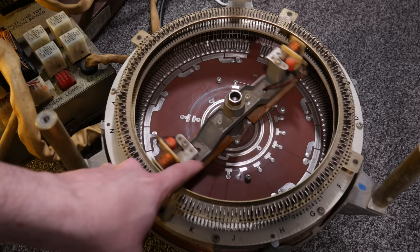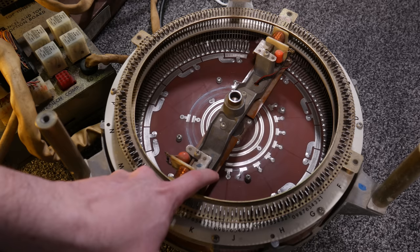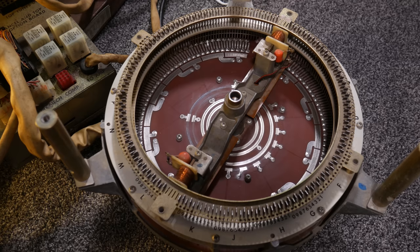But there were also even more expensive selections. They were called like the red button and the gold button, and they might take off 5 credits. So that's what's going on with all these patches. The armature could spin and go bup, bup, bup, bup, bup, fire the deduction solenoid 5 times, and there go your 5 credits. But one of the features that is absolutely enabled here is a brief release of the latch solenoid. If we go back to the clip of me just pushing this by hand, the camera's not positioned well for you to be able to hear it, but listen closely and you might hear the ka-chunk of the latch solenoid briefly letting go and then pulling back in.